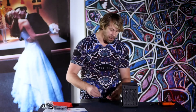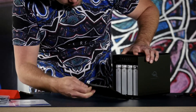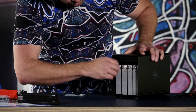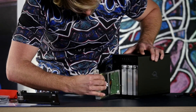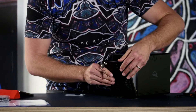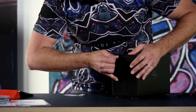We have some keys here — let's open this thing up and see what we've got. So inside, this is a 24-terabyte drive. I have four 6-terabyte drives, and as you can see they just kind of pull in and out. We've got a little bracket here that works really well, and these are already pre-formatted RAID 5. Now RAID 5 is great for backup — it backs up all my data as I go — but it's not the fastest RAID you can do.